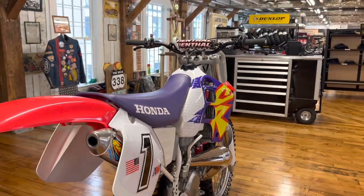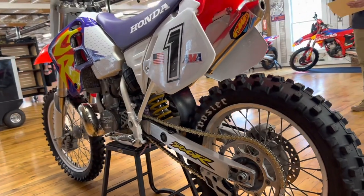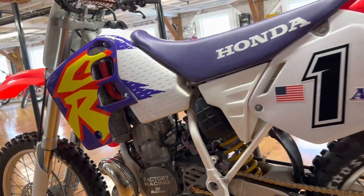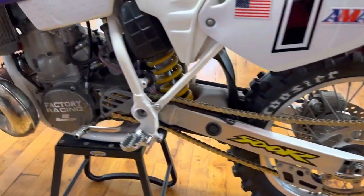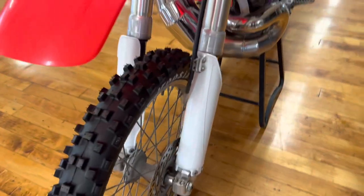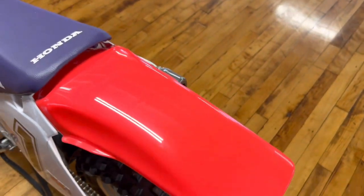This came from Keaton Tribe, a good friend of ours out west. He had the thing dialed in but when we sell a bike we've got to put our stamp of approval on it. It went through service — reasonable work order: cleaned and serviced the air box, cleaned and oiled the air filter, new Hoosier tires front and rear, new tubes, adjusted front and rear spokes. That was part of the 100-point hardware check — full hardware check, motor mounts, all hardware on the bike, spokes. New fork lower guards, new Sunstar gold racing chain, new Moose 34mm chain roller, new Renthal 7/8s.